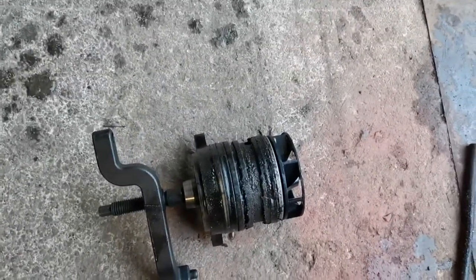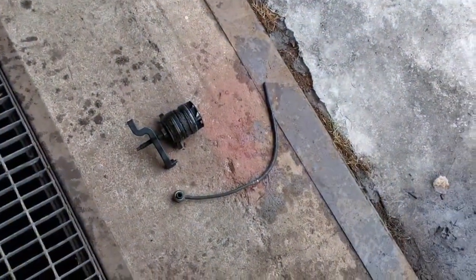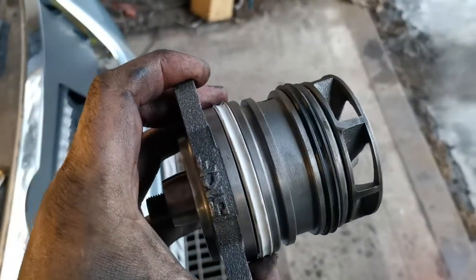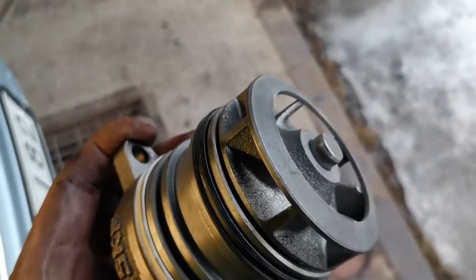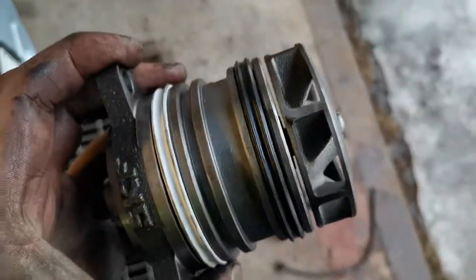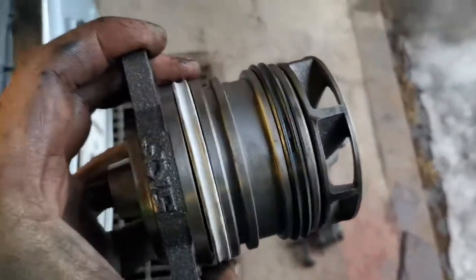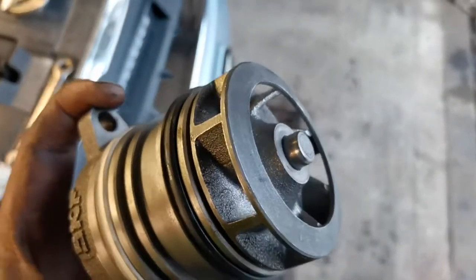But when this pump breaks, your whole engine will break because oil and water will get mixed, and that's really bad. So take out that thing, and when you change the water pump, they tried to sell me a cheaper brand product, but I trust a metal water pump, because if you get some kind of dirt in your system, the plastic one can break easily. This cast one doesn't break so easily, so it's much more reliable. The price was actually the same. So if you order it online, choose the SKF version that at least has a metal propeller.